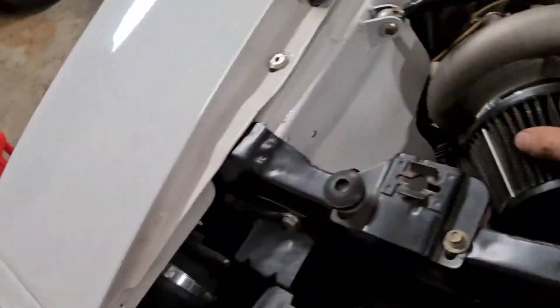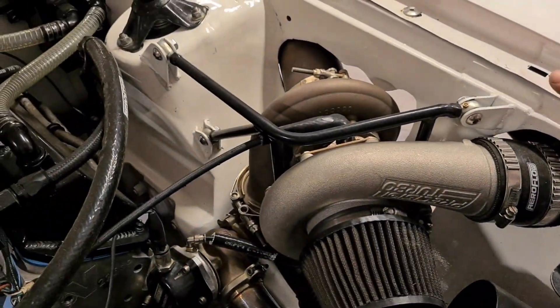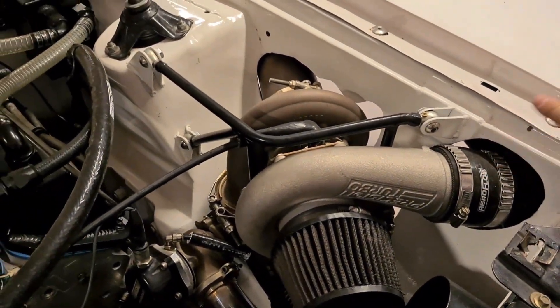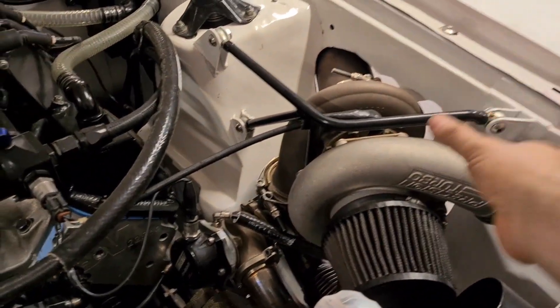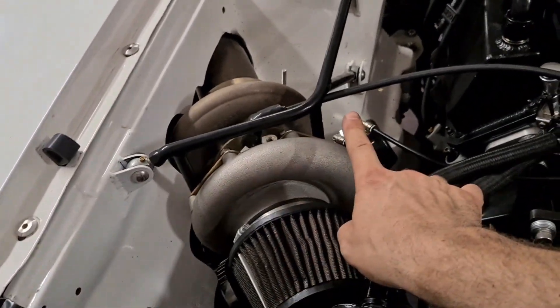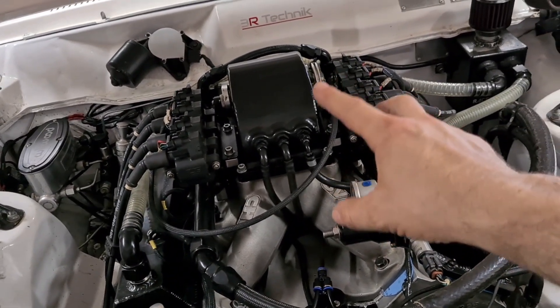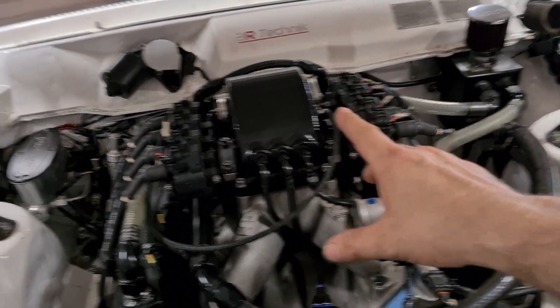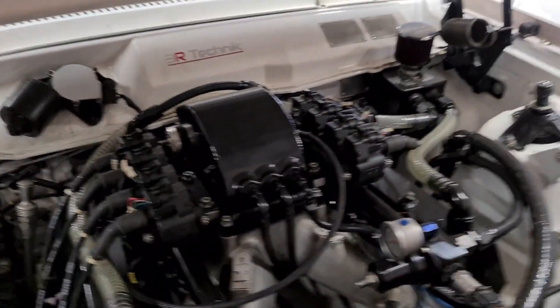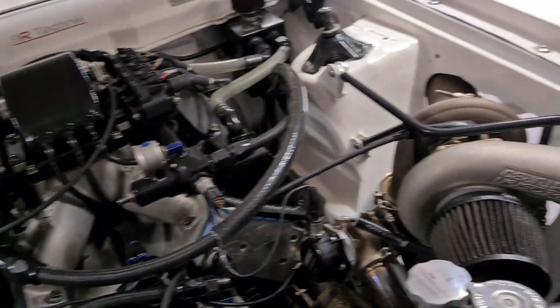The current plan is to leave these turbos where they are but simply disconnect the hoses. I'll probably leave those pipes fitted inside the car - they don't need to be removed - and simply rotate the housing around so the outlet now faces down. I do have another throttle body elbow being cast for me - a forward-facing one - so it'll just be two pipes coming straight from the turbos straight up into the throttle body with no intercooler.